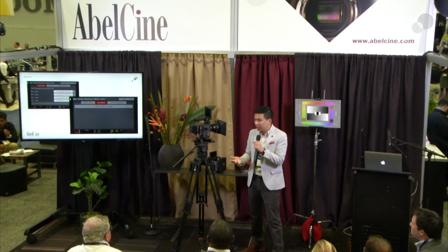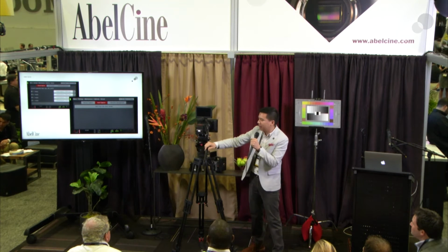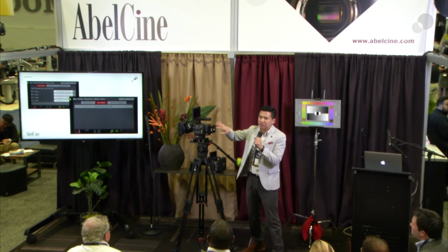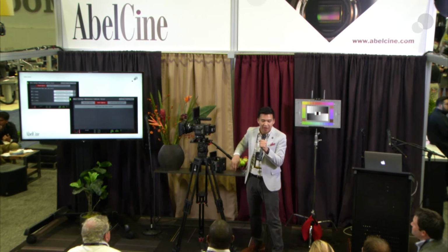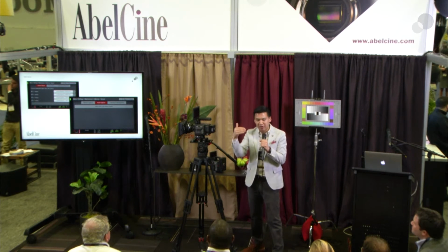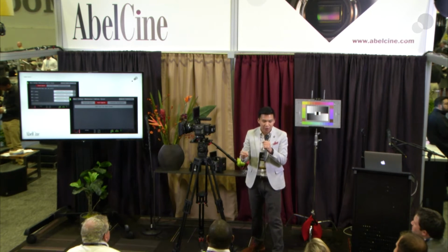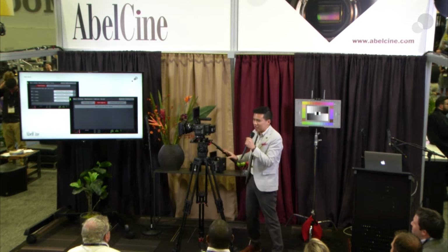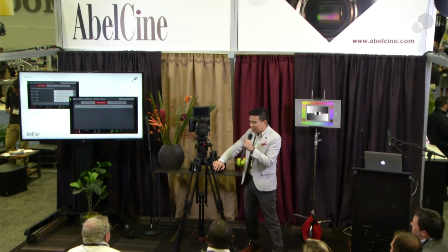Right, I don't have a slide for it, but one thing I did forget to mention, of course, is the ProRes recording and now DNxHD edition, simultaneous to your REDCODE RAW. So on the same mini mag, you'll have R3D as well as ProRes or Avid DNx files at the same time. Right? And you go through a drop-down menu, you have the option for QuickTime plus R3D or R3D only. So 3 different record options, and now I guess DNxHD, so you have sort of 4 options as well. So again, they've taken a lot of what's really worked, what folks are really already comfortable with.